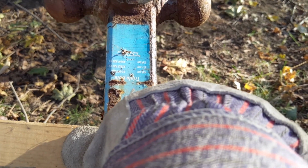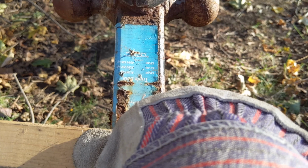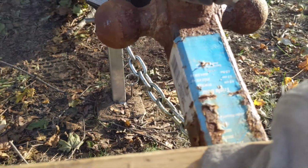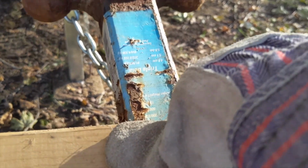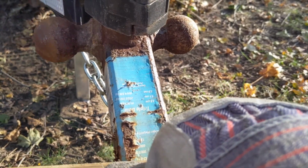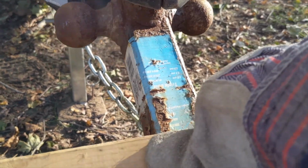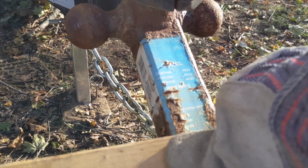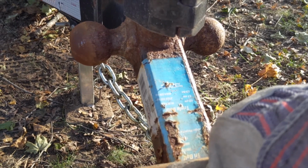Yes, it does form a crisscross underneath that, in the event of a severe problem where the hitch were to come uncoupled or something, it could potentially catch the tongue of the trailer and prevent it from nosediving right into the ground. Yes, it could. But that's not the primary reason. The primary reason is, well, math, geometry. So at any opportunity that you get, cross the chains.